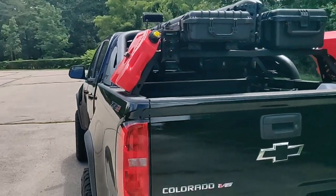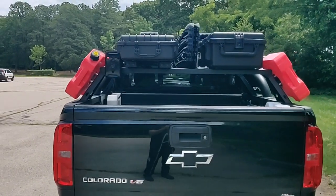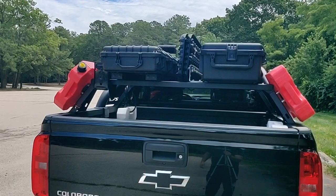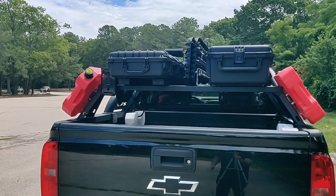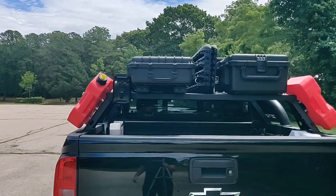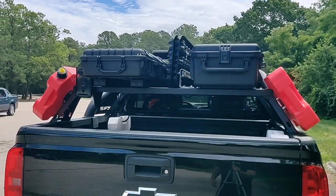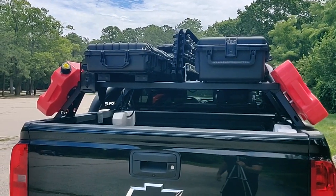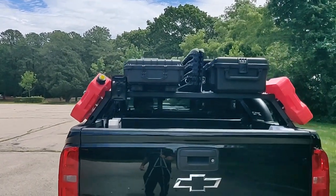What I will say is this aluminum extrusion is a lot heavier duty than I expected. This particular extrusion here was their 1.5 inch by 3 inch. It's heavy duty. It's overkill for its application here. It looks stronger than the actual steel crossbars. So I would recommend if somebody wants to use some of that aluminum extrusion, they just use the 25 millimeter by 76 millimeter, which is what, 1 by 3. I think that's more similar to what's used on some of those racks like Prinsu.